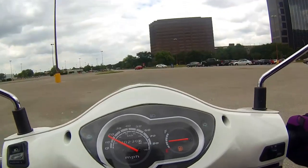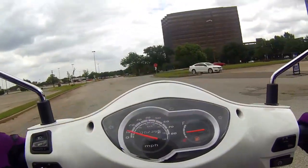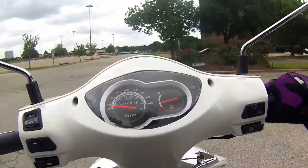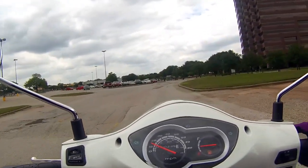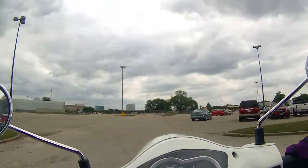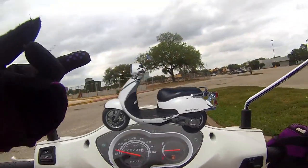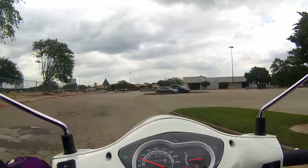The reason I want to talk about this is because of my little accident — and not all scooters have ABS. ABS is a beautiful thing, because locking your wheel — which is what happens if you don't have ABS and you slam your brakes too hard — can be dangerous. If you're going at major speeds and you lock your front wheel, your back wheel is still trying to go, so your whole back end comes up in the air and you get thrown off your scooter or motorcycle. But ABS prevents all of that.